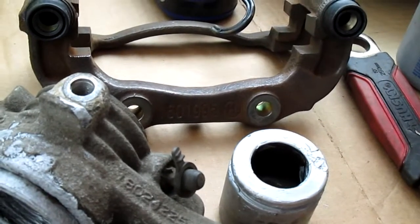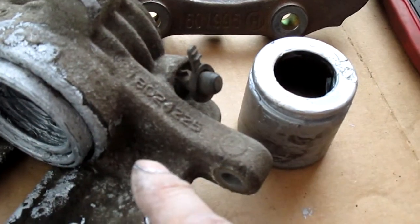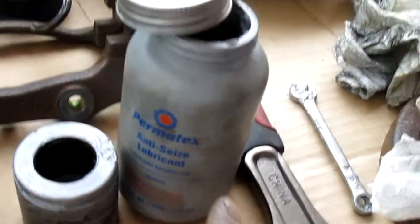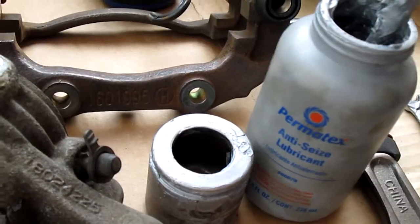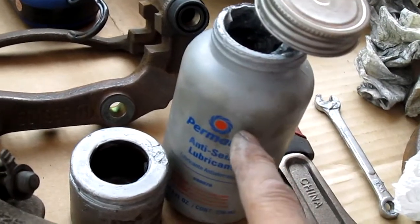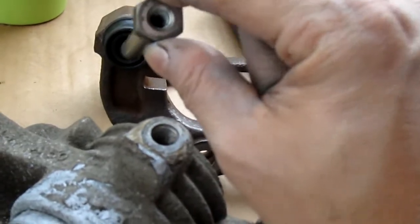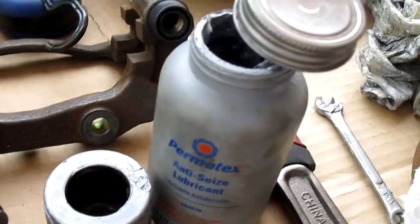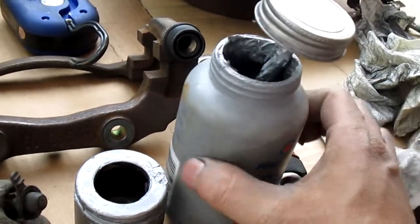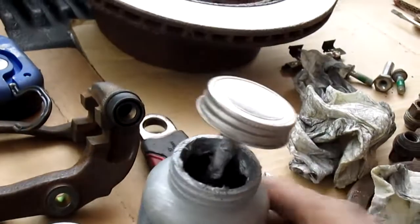Another thing you can do is take grease and mix it with anti-seize. This jug right here is actually nine dollars — I don't care, so I put a bunch of it in there. But if you're trying to save money, mix 50/50 and put it inside here on these pins. Put the anti-seize on these pins rather than just grease. The agent they put in here is sort of like a thermal paste — I believe it's liquid silicone and silver particles. They probably won't tell you what's in there because they want to hide their formulas.